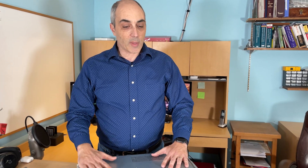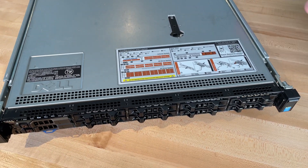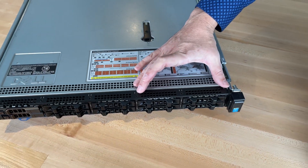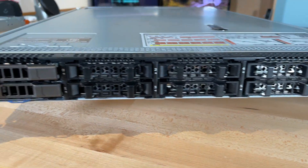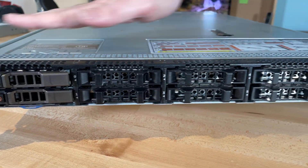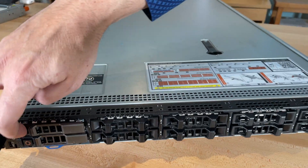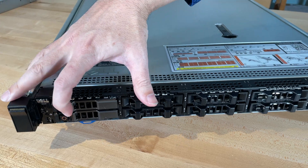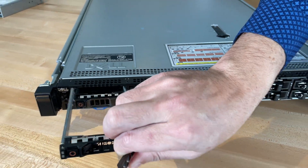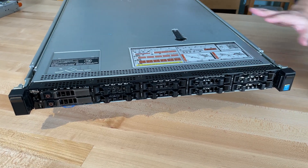Let's take a quick look around. These servers are customizable — when you get one you have the choice of how many bays are set up. The most standard configuration is eight bays in the front, but this particular one does away with the CD-ROM and has an additional two bays, giving ten total. These bays take two-and-a-half inch drives, so traditionally these would be SSDs.